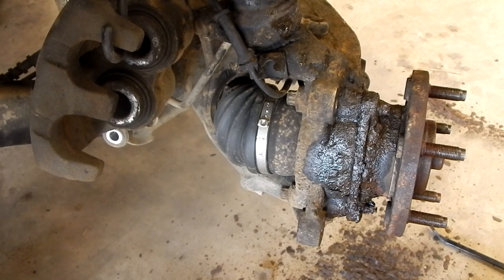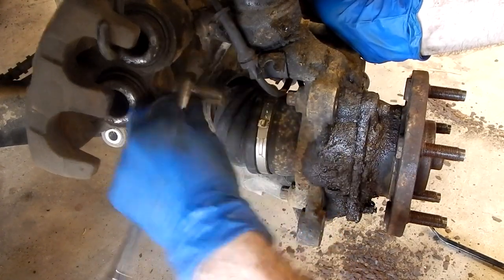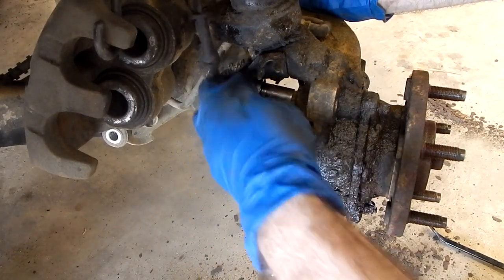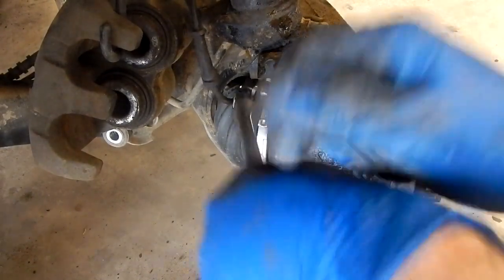I've seen one place referencing that they're half-inch and a half-inch fits, but I can tell you on my particular one these are metric threads — they are a 13mm 12-point metric head on the bolts. So let's go ahead and take those off; we've got three of them. You want to make sure you work them on good. Make sure your ABS wire isn't in the way — take it out of the bracket at least. Get it on there nice and good; you don't want to round that 12-point head off the bolt. There's one, we'll get it started.